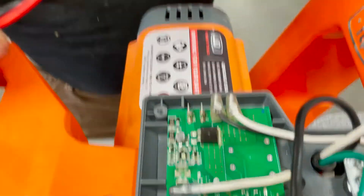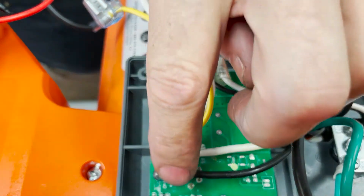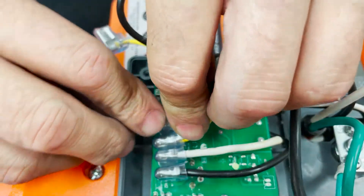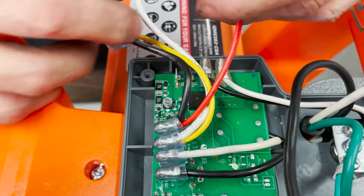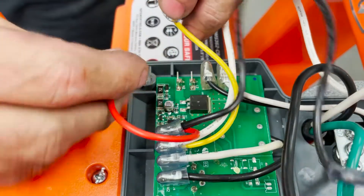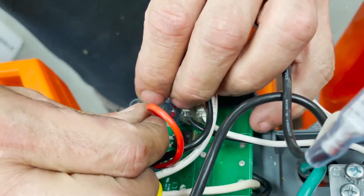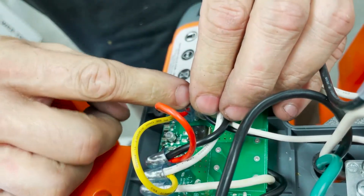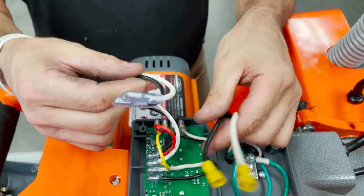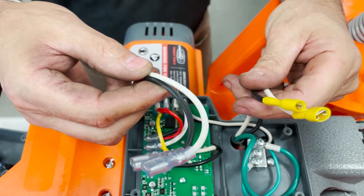Okay, so the flag connectors should be connected to the PCBs. So in this case: black, white, white and yellow. Black and red. And then the white and yellow will go on to the vacuum side to provide power to the vacuum — red next to black, then yellow first. So you should have yellow, red, black, white. Then you will have the black and white connector — this is incoming power with the yellow terminals. Outgoing power from the switch to the PCB here.